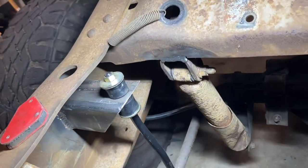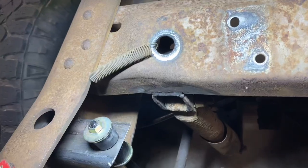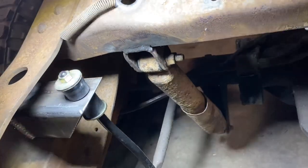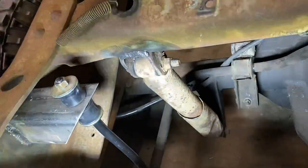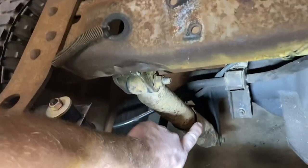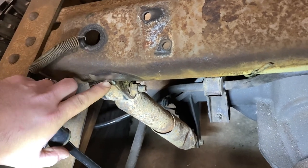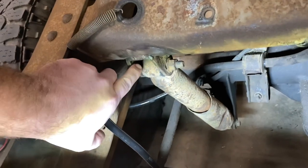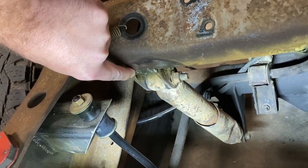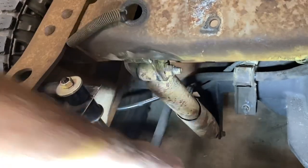The other thing I did — as you can see in the same frame — is I swapped out the factory mounting hole for the factory van shock. On that same 2008 to 2010 axle, I took the shock mounts that bolted down to the axle on the newer trucks. As you can see here, they're welded to the frame, but the earlier ones were bolted. So on that axle I was able to unbolt those, take the partial shock mount, and weld them in place on this cross member. Now I have a through-bolt on both ends.